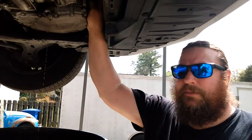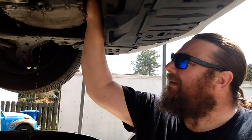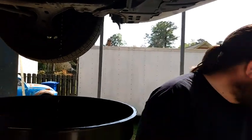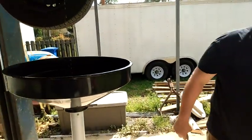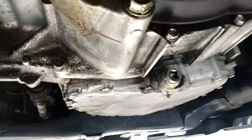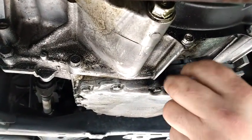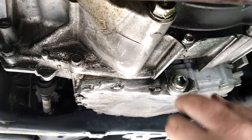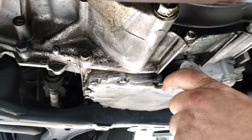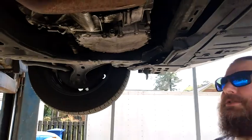Then we're going to get it running and pull the plug back out, and the fluid level will go down because it's filling into the torque converter — the torque converter is pretty big and it takes a few quarts to fill it up. Put our drain plug back in — not too tight; you want to be able to change it again later. You don't want to have to replace a pan because you stripped it.